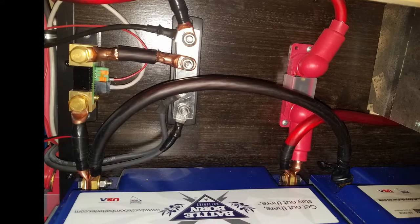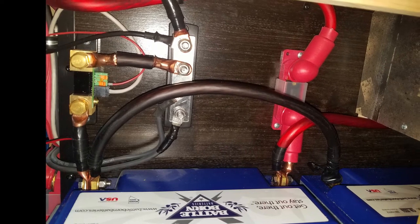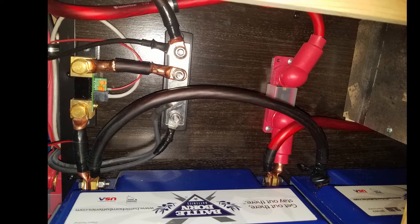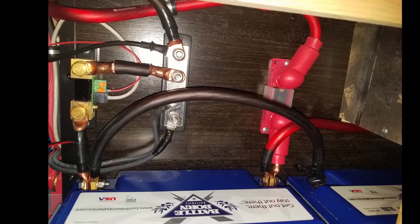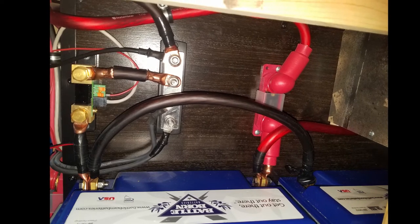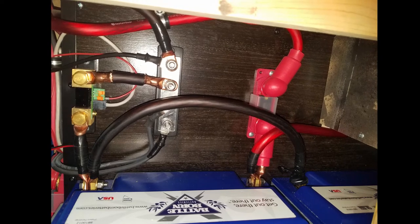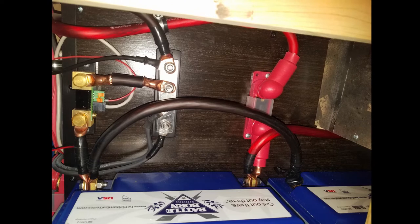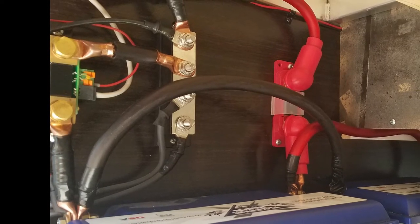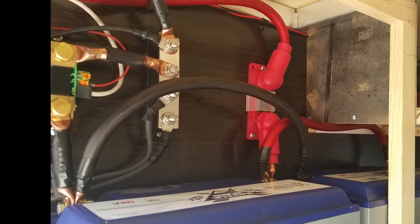This first photo is the two batteries sitting side by side. The red lead is your positive lead and there's a fuse right there. On the left side, the black battery cable comes up into a current sensor, and that powers the Victron 712, which allows you to see the battery conditions — how much you're drawing, how much you're charging, etc. That's a really useful feature to put into your trailer. From there it goes over to the bus bar, which is the negative side of the bus bar.